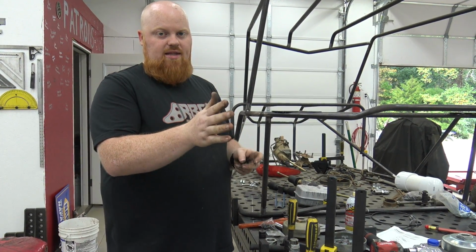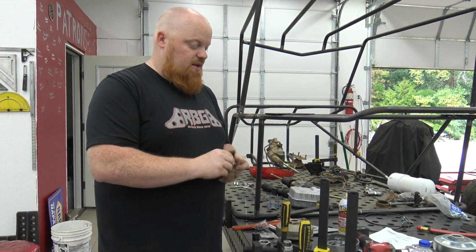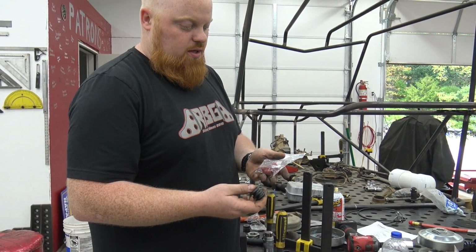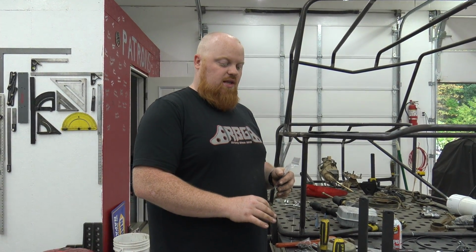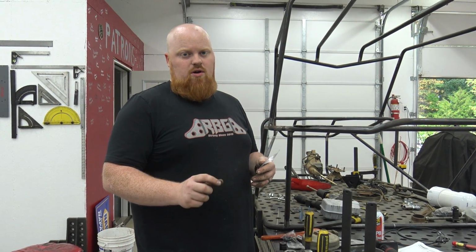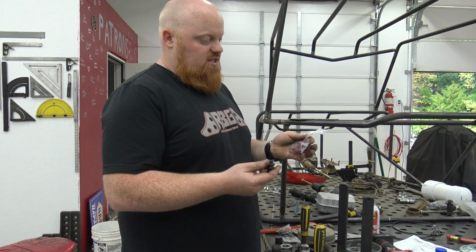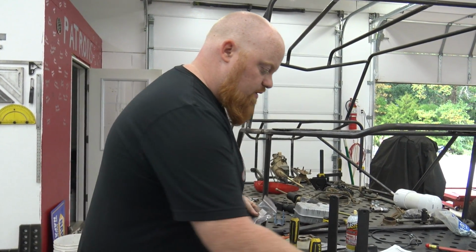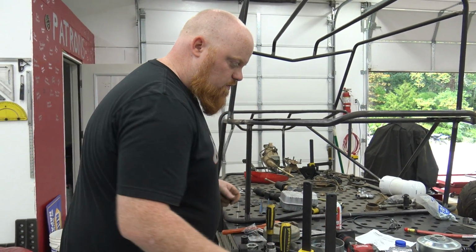It means the pulley's not gonna start pushing on the belt to actually take the go-kart off till 2600 RPM if we do the red springs and the medium rollers. I don't like the 1600 RPM engagement that they come with, because that's too close to the idle RPM. As soon as you come off idle, it's taking off. I like to have a little bit of rev up, especially when you're starting and have to feather the throttle. It's nicer to have it rev up a little more before it starts engaging and takes off. And I just think it's better on the clutch.